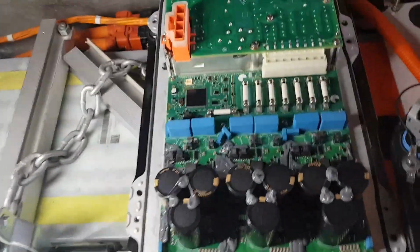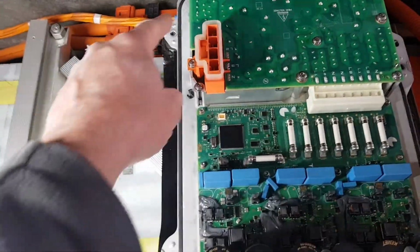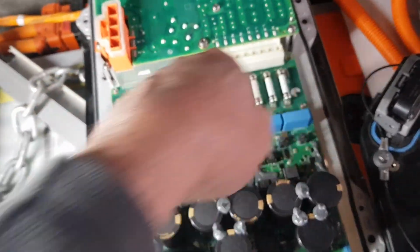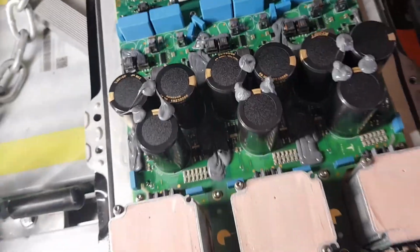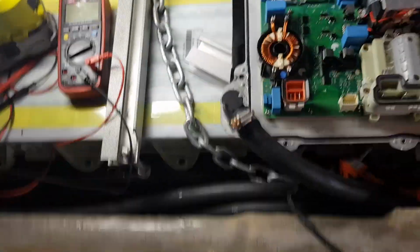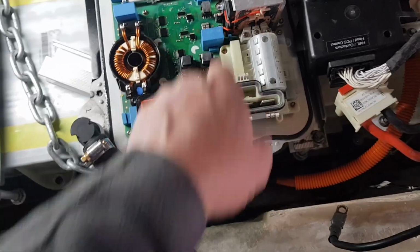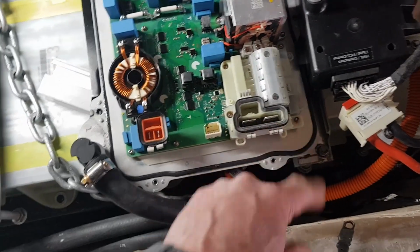So we're into the guts of the PCS. We've got the 3-phase AC input from your EVSE that goes in here, and all the fuses are populated, unlike the American ones which only have single phase. So that's all the AC input side. This is the high voltage battery input, and this is the 12 volt DC charger, which takes this and converts it into 12 volt.